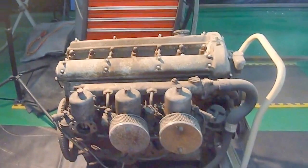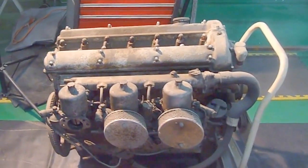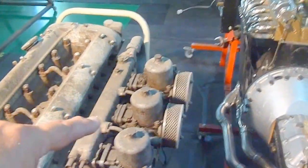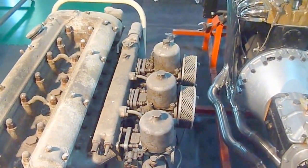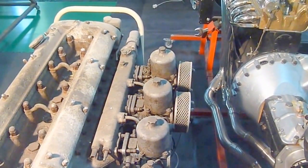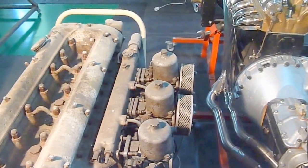This is actually a Mark 10 spare engine in quite a bad state as you can see. A lot of people think that you can use this because they are HD8 carburetors — you can use this onto the E-Type — and unfortunately you can't. This manifold, this inlet manifold is wrong, and it's a misbelief that you can just swap it straight on. They're too high; they're actually something like 50mm too high.